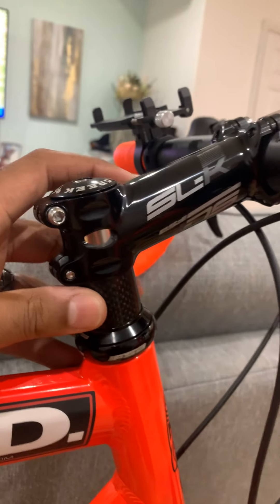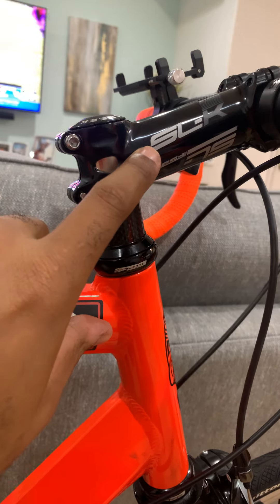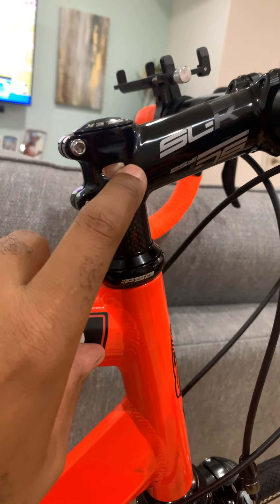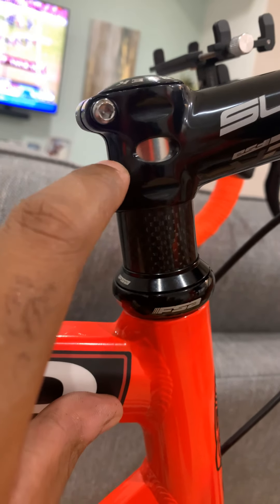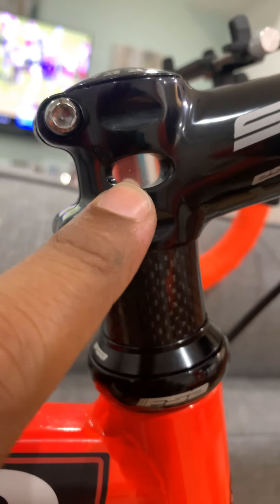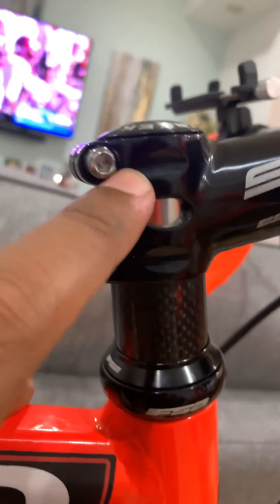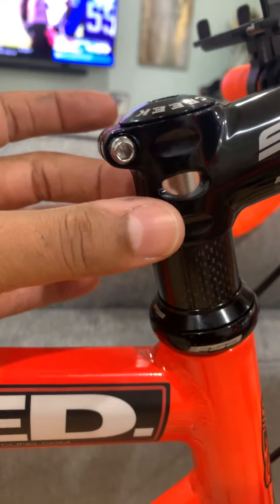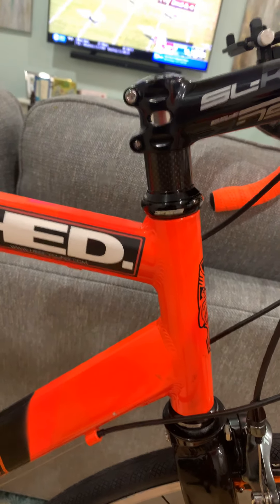When you put a one-inch steerer tube in here, you won't find stems that fit on a one-inch steerer tube. The best thing to do is go with a one-and-one-eighth-inch stem and get a shim that converts from one-and-one-eighth to one inch. The silver piece inside is a Thompson stem shim — those are about seven to eight bucks on eBay. It fits inside the housing and takes up the difference between the steerer tube and the stem, allowing the stem to sit flush. Spacers go underneath, giving you the look of a one-and-one-eighth-inch steerer tube.